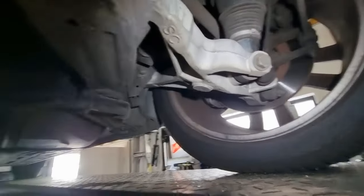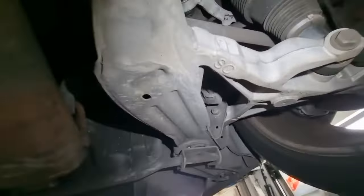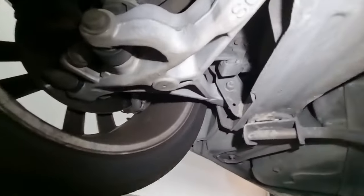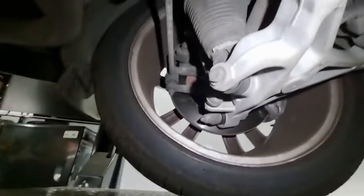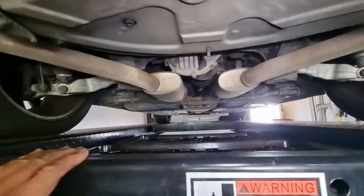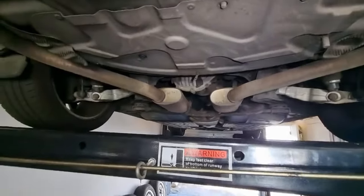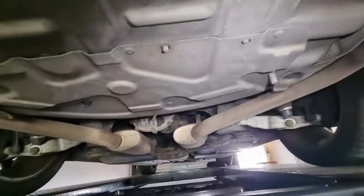Okay, well, that's interesting. But lots of things, the upper control arms look like they've been replaced at some time. I think, actually, I do have a receipt for that. And the lower ones, they look like they might have had new rubbers pressed in, I think. And I had a receipt for that as well. But we'll just check to make sure there's no movement in any of those in a little bit. I'd actually really like to look under another XJR and see how the exhaust system is fitted, because they're definitely not genuine, and I know they're not. Is that tight? Yeah, all right.